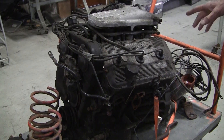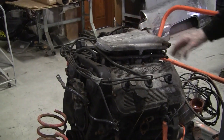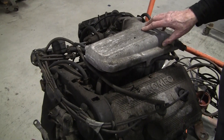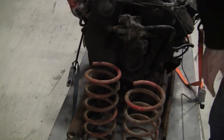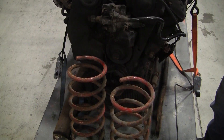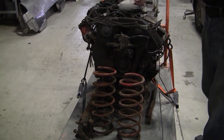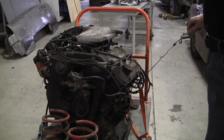It's a 2.5 liter and it puts out 157 horsepower. It's fuel injected. This is a big protuberance up on the top here, which we might do away with by putting carburetors on it so it won't stick up as much instead of the fuel injection. We didn't know if it was frozen. I looked for a 42 millimeter socket — I believe that's what's needed — but I put a pair of water pump pliers on it and grabbed the pulley, and lo and behold it moved really easy. It's free — that's a big good sign. The oil is nice and clean in it; it had been changed recently, and that's another good sign.